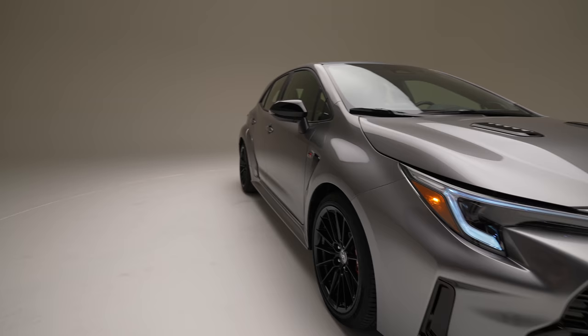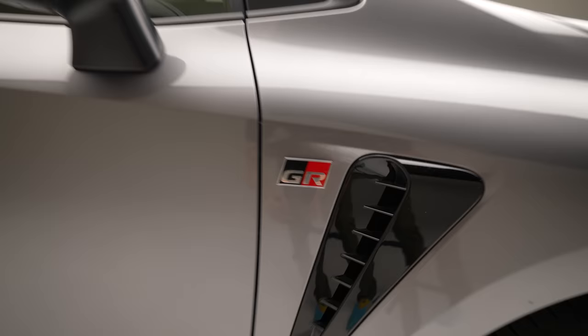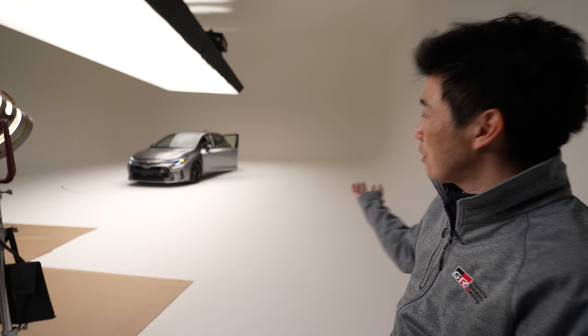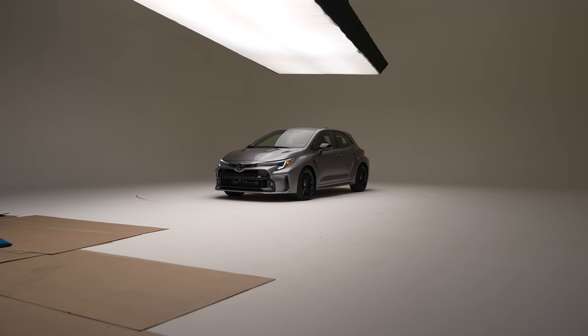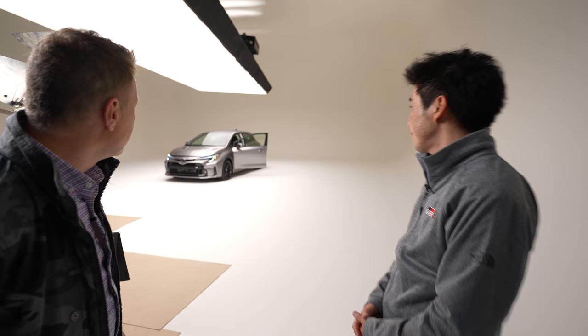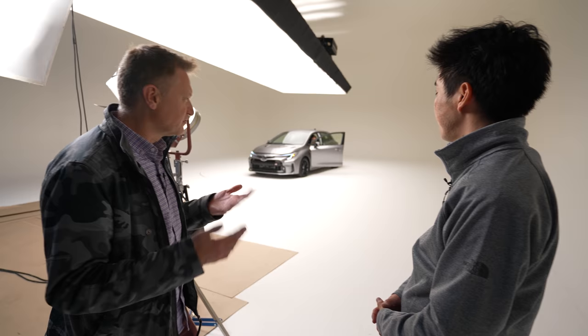There's a lot of weight reduction in this vehicle — how did you take weight out? The carbon roof is one point, and the other is a lighter front suspension member, which also creates better suspension geometry. On the suspension member alone, we reduced five kilograms while nearly keeping the rigidity by optimizing the structure. The front suspension member itself is steel, because rigidity is important. Overall this is only about 30 kilos more than the regular Corolla, even with all-wheel drive and all this additional technology.